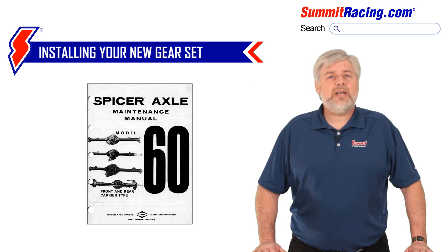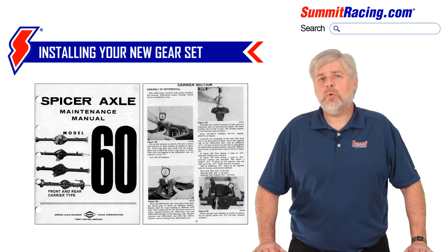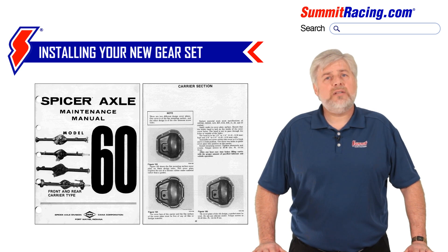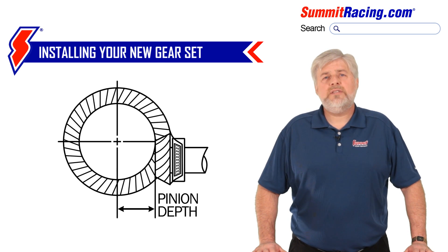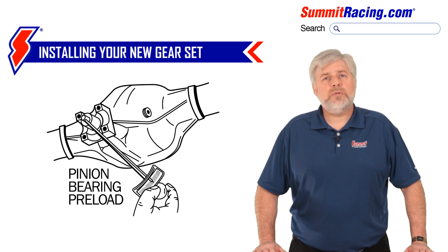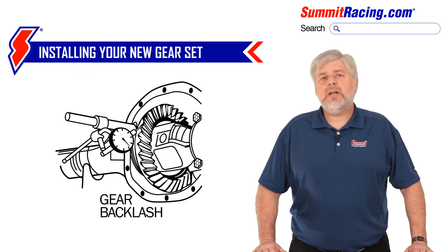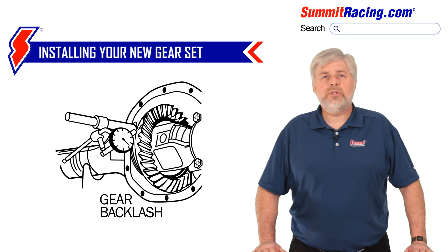Just having the tools is not enough. There are specific procedures and torque specifications that vary per axle, which is where obtaining the correct service manual is a big help. There are three critical measurements that must be accomplished. First is pinion depth, which assures that when the engine's power is applied, the gear contact patch is correct for the quietest and strongest installation possible. Second is pinion bearing preload, which assures the tapered roller bearings don't run too tight or too loose in their races, causing noise, undue heat, or looseness in the driveline. And third is backlash — best thought of as an air gap between the teeth of the ring and pinion during final assembly — important for part expansion due to heat and for proper lubrication of the tooth contact surface.